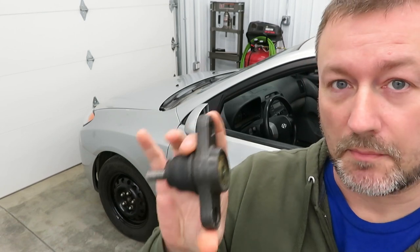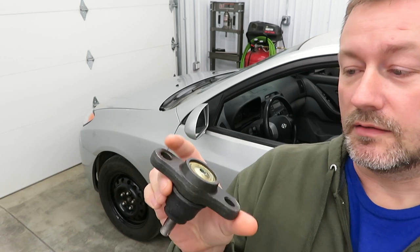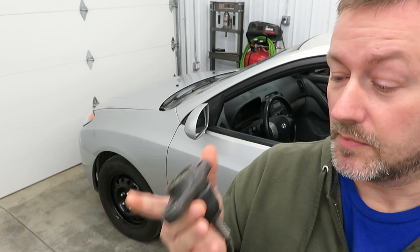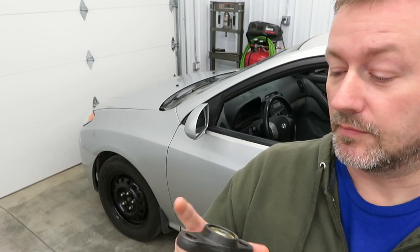Let's take a look at it — there's something kind of interesting about this. I've not done any ball joints this style before. This is actually a bolt-on, so it bolts up to the knuckle and comes through the lower control arm. Most of them are press fit, so hopefully this design makes it easier to install.